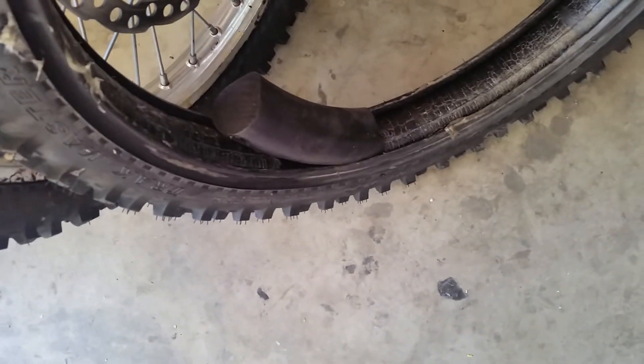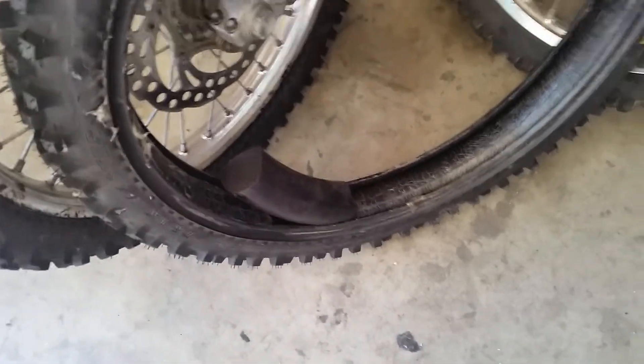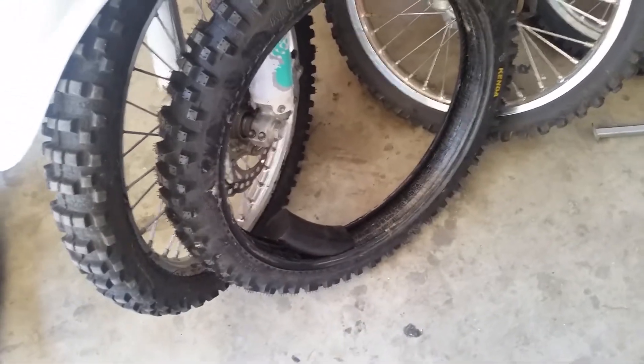So what we do: we cut it open, take a piece from another mousse, stuff it in there, get that tire nice and full. And that is how — front or rear — you get the most life out of your Michelins, out of any of your mousses.